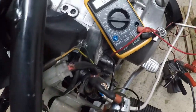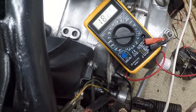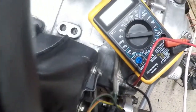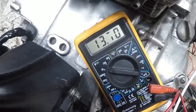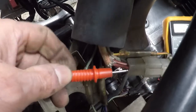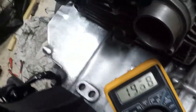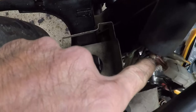Testing the feed in, I'm getting 13-point-something volts. Following the cable down to that point - 13 volts. Following it to this terminal - voltage should come up this cable and into the back of these connectors - yes, 13 volts across both. The red cables are fine. Let's get the book out and trace those.